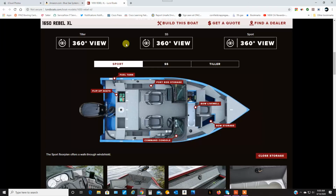Okay, so there's one other thing that I want to mention: the pull string. If you open up this compartment right here, under here, you'll see some pull string. And if you open up this big circle cap, the motor cables are covering it up, but you turn that about 2 or 3 times, you'll see the other end of the pull string. Now, I would highly recommend you watch the video in this playlist, or if you're not watching this video in a playlist, I'll link to it below. There's a great video on how to pull wires through conduit. I would strongly recommend that you watch that, because you will lose your pull string if you do not do this properly, pulling that through from here back to here.